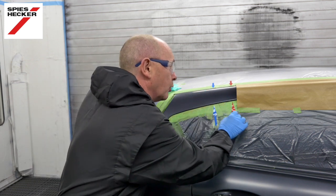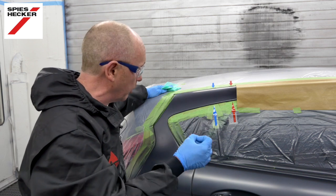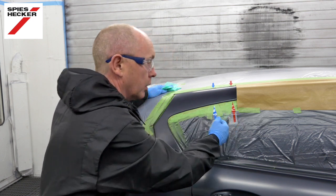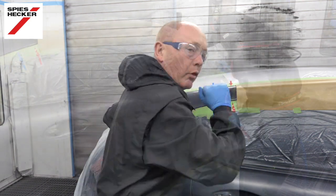I'll flash it off, then peel my paper back — which I've put there just to reduce the overspray a little bit and help me later — before extending the clear on the second coat to the area which has been finer sanded, indicated by the red arrow. Finally I take my fade out thinner and make my fade out on the polished zone.